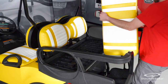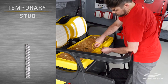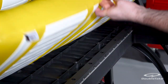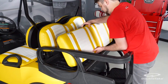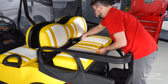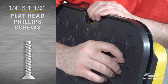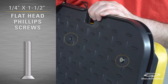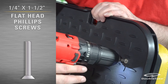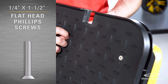To install the rear seat bottom cushion, begin by flipping the seat over with the label side towards you. Screw in the temporary stud into the center hole closest to you and then slip the seat strap over it. Hold the seat strap in place while you turn the cushion over to align the stud with the center hole of the rear of the folding cushion plate on the seat base. Keep a firm grip on the cushion and tilt the seat base up close to vertical. Insert the flathead Phillips screws to secure the cushion to the cushion plate and tighten all screws uniformly.